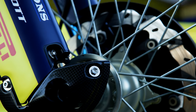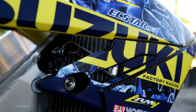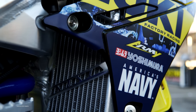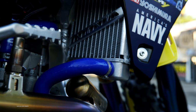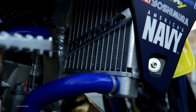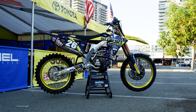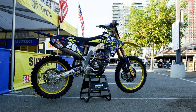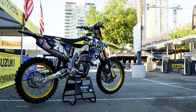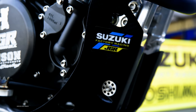The front axle is steel. The radiators are standard Suzuki for the 250, but they are braced so riders don't bend them with their knees — they squeeze pretty hard. Standard routing with a little bit better hose than stock. For cooling, we run a 1.8 radiator cap. We've tested aluminum ones and tried a few different things, but ended up with a carbon fiber skid plate that we make at JGR. It bolts onto the side where the plastic guards usually fit.